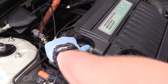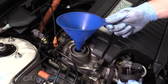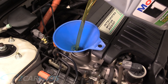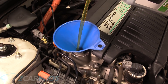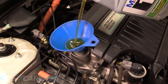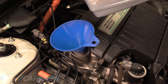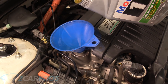The next thing we're going to do is remove the oil cap and place a funnel. Honda says this engine takes 3.4 quarts when you've changed the oil with the filter, and four quarts if you've completely overhauled the engine. So we're going to put in 3.4 quarts and check it. For oil today we are using Mobil 1 0W-20 — full synthetic, recommended for many Hondas, GM, Nissan, and Toyotas.